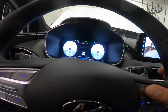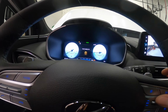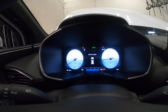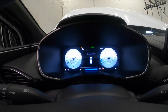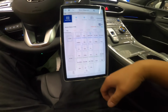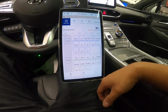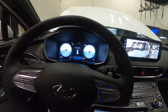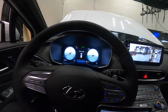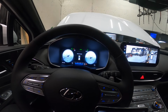So earlier, it says here, okay, let's go to the triangle here. It says there are check LED, headlight, check turn signal. So right now I'm just scanning for any codes, just in case. And also the weird thing on this one, I don't know, maybe it's a default, every time you remove the negative cable on the battery and you reconnect that, the tailgate opens by itself.